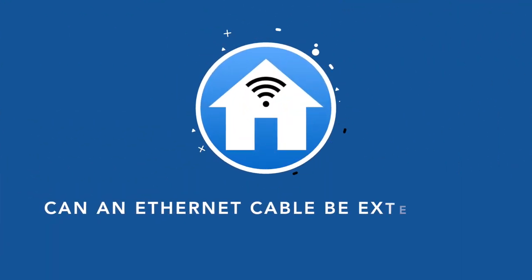It is possible to extend the reach of ethernet cable past 100 meters, but you'll need some extra equipment. Remember, you can't exceed the 100 meter limit of a single cable, but you could place a network switch in the middle to extend the overall reach. The switch doesn't even have to be particularly close to either the router or your end device — as long as each cable run between the router and switch, and the switch and end device, is both less than 100 meters, they can all communicate. While ethernet extenders are an option, my recommendation is to only use them temporarily. For a permanent solution, invest in a very cheap and basic unmanaged switch, which would do the job just nicely.